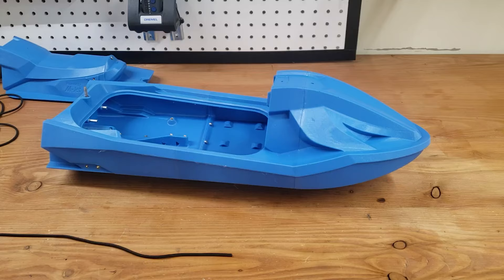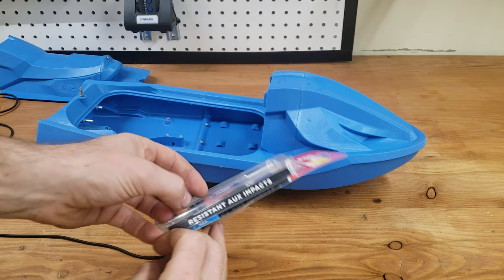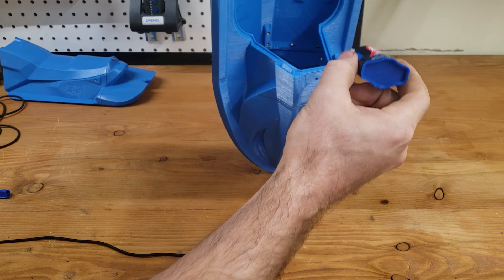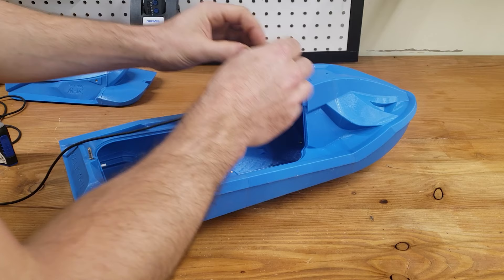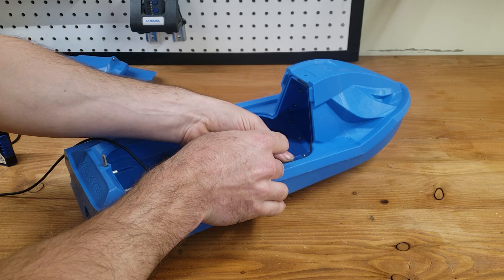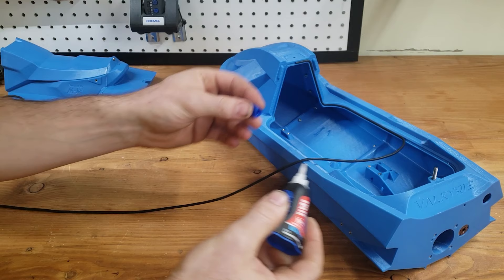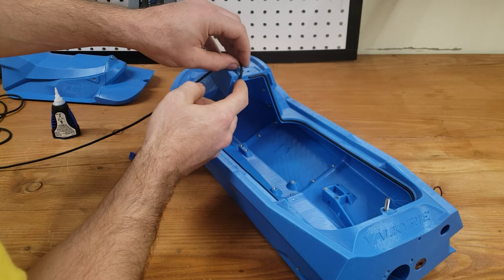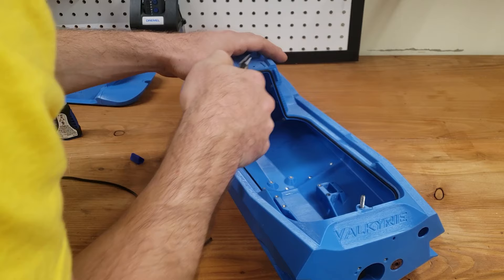It is the next day so we're gonna start right away with installing the rubber seal. I have tested all kinds of glue to hold this. The best results I had were with everyday CA glue and ultra gel CA glue — don't use epoxy or any other types of glue, they might not hold as well. Start at the top and apply a very thin continuous bead on the track and gently push the seal in place. Use your finger to gently guide and push it in — don't use a tool like a screwdriver for this. If you put a small amount your fingers will stay dry. Don't stress the seal or compress it, just let it find its spot by itself.